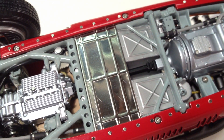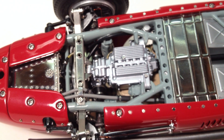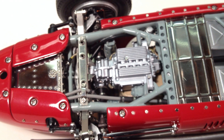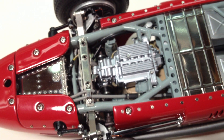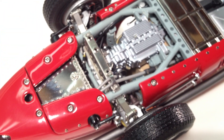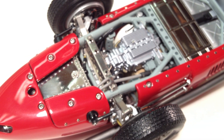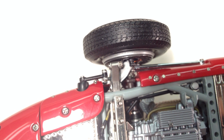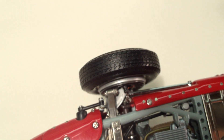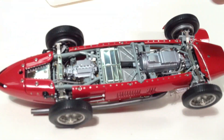At the bottom of the engine you again see the gray-painted steel chassis and aluminum floor pans. Here's the rear transaxle — although it's a front-engine car, it has a rear gearbox and differential with independent half shafts. It's a de Dion rear, meaning the two rear wheels are still connected but with a semi-independent suspension. You can see the hand-riveted fuel tank inside, and from this view you get a look at the Houdaille shock and big drum brakes.